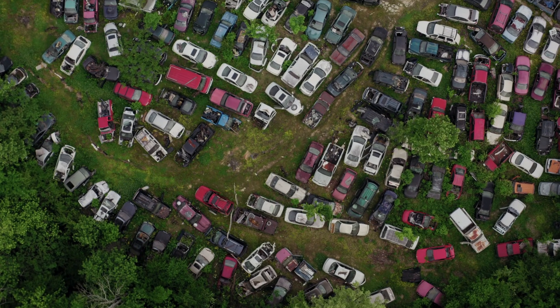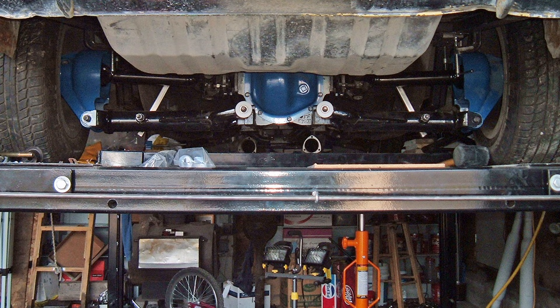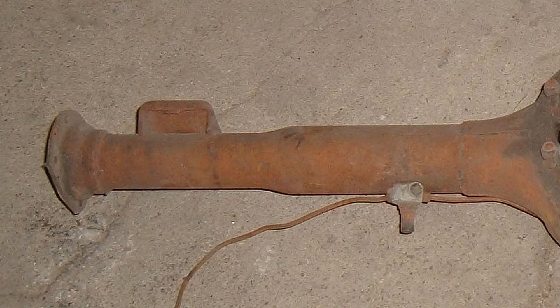The answer is correctness and cost. I'm not too big on correctness — I'm putting a Jaguar rear-end in my Mustang, so it doesn't have to be period correct for me. But for a lot of people, having a period-correct 9-inch is more challenging because the 9-inch housings that came in 64.5 through 66 have tapered axle tubes. If you get a rear-end out of a Ford Granada, it'll be the correct width, but it does not have the tapered axle tubes. That's going to require different U-bolts and different mounting brackets for the leaf springs — it's not going to be period correct.